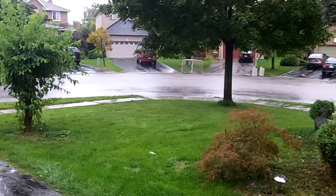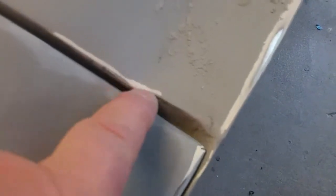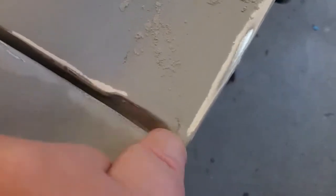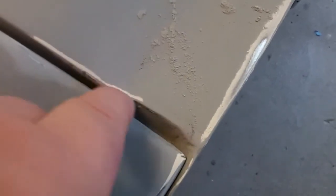Alright guys, we'll give you an update later. I think what I'm going to do first today is actually fix this little cut out. I think that was like that from the factory — this panel wasn't replaced. There's always been this little offset in this rear panel. So I'm going to throw a little bondo in here and shape that out. I'm going to grind that back down to bare metal to make sure I get a good adhesion there in the corner.